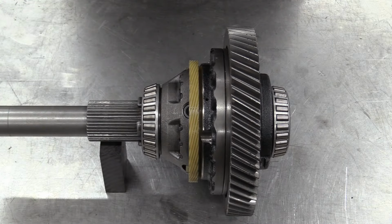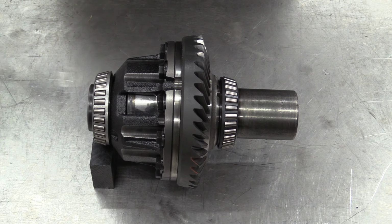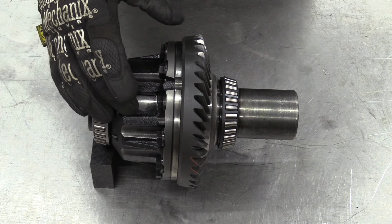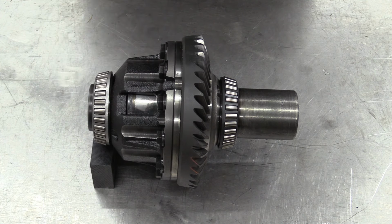Now this is of course useless as a four-wheel drive system because both the front and centre differentials are open, so you could still in theory get one wheel spinning, and that is where the central viscous coupling comes in. The viscous coupling is just this shiny bit here, and inside it there's a stack up of metal plates with holes in running in a thick oil. Everything inside here is carefully engineered so that the plates can turn relative to each other at low speed. The minute that becomes high speed, the oil is too thick to get around the plates or through the holes, so it locks all of the plates together.